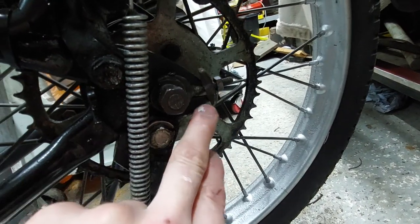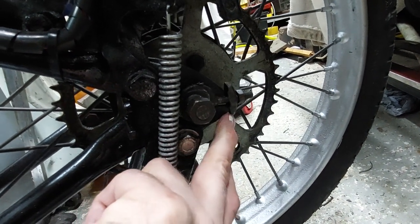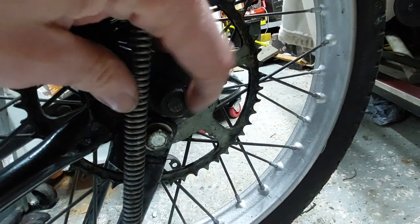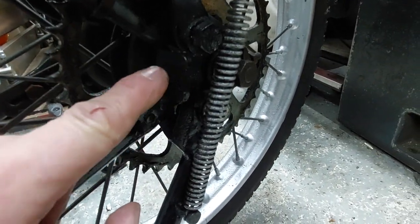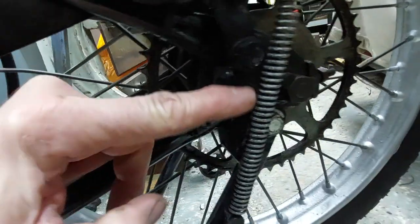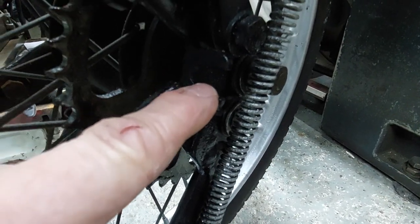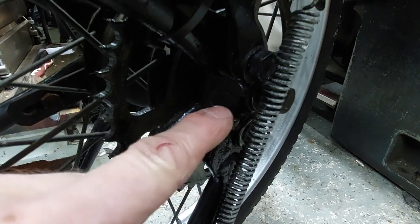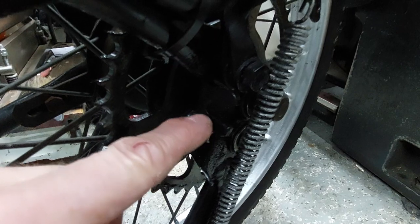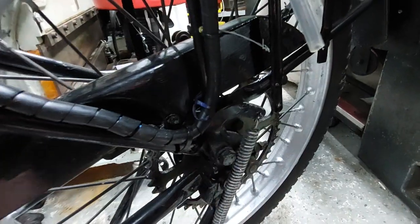These aren't correct, these rear wheel adjusters. As you can see, the frame's not designed to take it. It finishes earlier here than it does down there, and these have been done up and they pull at an angle and have bent the threaded bar. These slots here, I don't know if you can see, these slots here are for the original adjusters, so they push the axle back. Can't quite figure out how they didn't fall out or how they worked, but I'm still looking into that. Not sure if somebody's modified these, maybe cut them out. Maybe they were a threaded hole originally with a bolt going through. Not quite sure. But yeah, need to get rid of these and sort something out there, because I think all this spring for the stand should be back here, not hooked up here out the way.